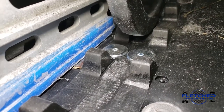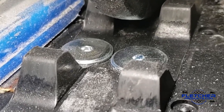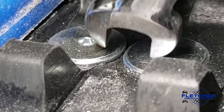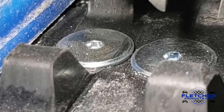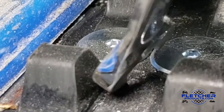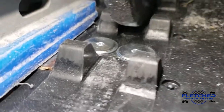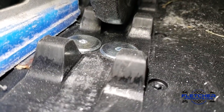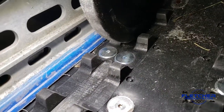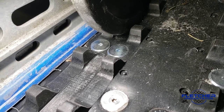Here's a different shot looking at one of the double backer setups with the Snow Studs head. You can see that chamfered edge, which allows the bogey wheel to roll over them very nicely. They don't stick out far — they're nice and flush with the track — and you don't have any of that harshness that you do with the other studs. Much better design, longer life out of your bogey wheels, longer life out of the stud, and it just doesn't get damaged as much.